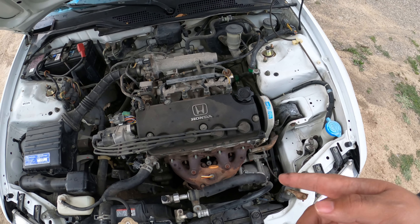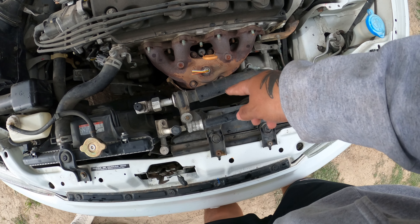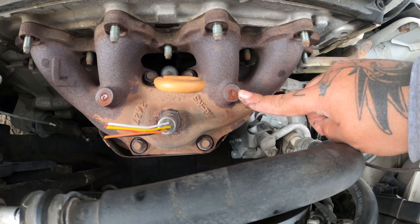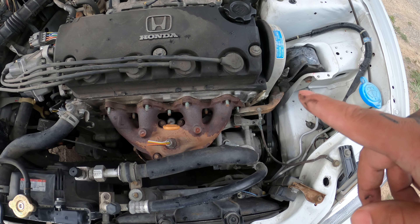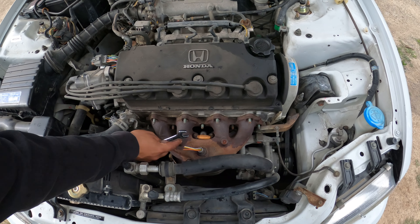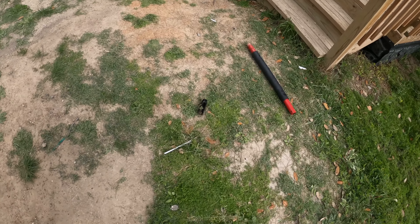This car is a '92 — that's 30-something years old. This stuff wasn't coming off, it's fully rusted. Thank goodness the bolts on the headers were good to go, but you can see the other one was completely separated from the bolt and the thread. You gotta take off these nine bolts from the header — they are 12 millimeter — as well as these, also 12. And for the O2 sensor it's a 7/8th wrench.